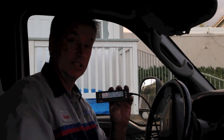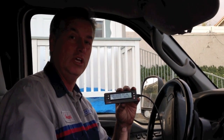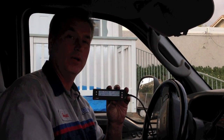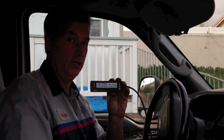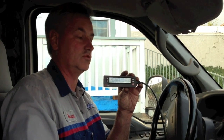So as you can see, this is more than a novelty — it's a genuinely useful gadget. It can literally keep you from breaking down, or at least help you avoid it. As I make different diagnostic videos, I'll always refer back to this tool. For a 6.0 owner at $159, this is something you need. I'm going to start using it as a diagnostic tool in real jobs — monitoring oil temp, coolant temp, restricted oil coolers, and diagnosing crank-no-starts.